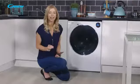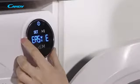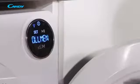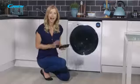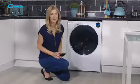Press and hold the set button for three seconds once again. There will be two options: Easy Enrollment or Standard Enrollment, and for this process we'll be using Easy Enrollment. Press and release set on the machine and the display will show connecting. Back on the app, press the arrow button to move on.